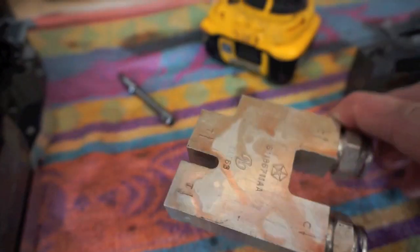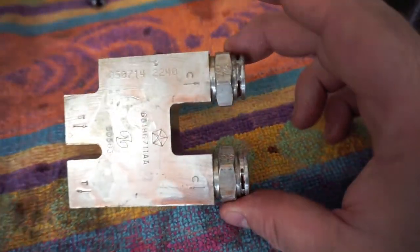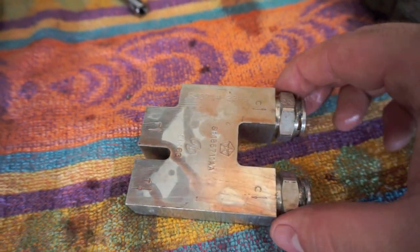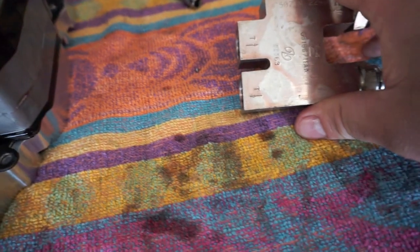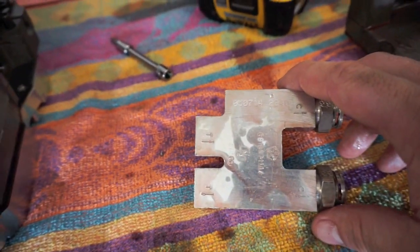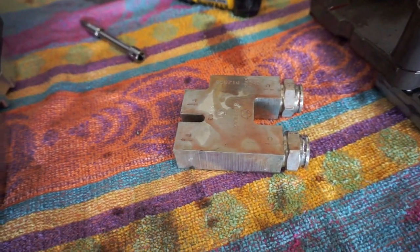and they're freaking awesome. So this is the old one, new one's in, and like I said, for those clips, you just pull them off with a pick or a scribe. Those come out, those lines come right out, and they just pop right back in. That was pretty simple. And if you guys saw me under the truck there, I was getting covered in trans fluid, just trying to get these lines back in because I didn't want to drain them all out from my trans cooler. So got that done. That was an easy 15-minute install.